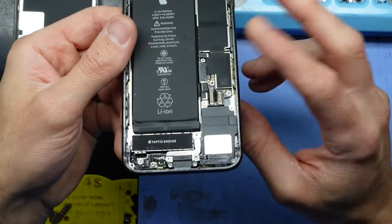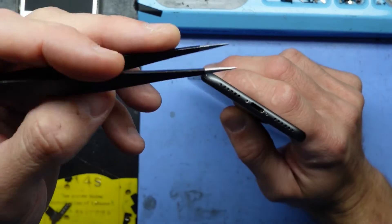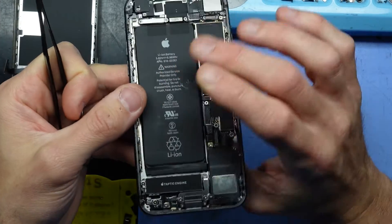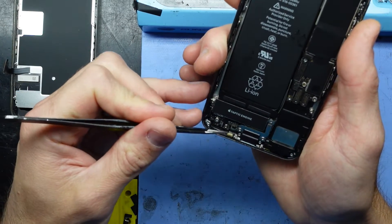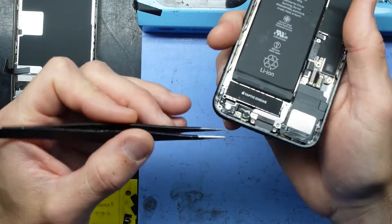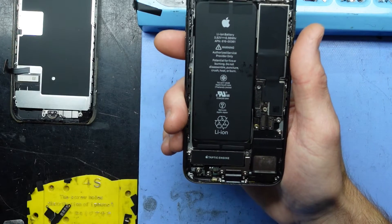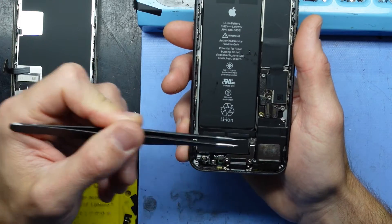With it being an 8, the two most common faults I normally see are the charging port — with a little bit of experience and a very fine tipped tweezers this can be cleaned out relatively easily and kept going about 70% of the time without needing to replace the charging port. The next most common fault is the microphone, which tends to fail. Usually if you're getting weird static noises and you've already cleaned the grill, you can proceed into a full charger assembly swap which would involve taking out all these components here.